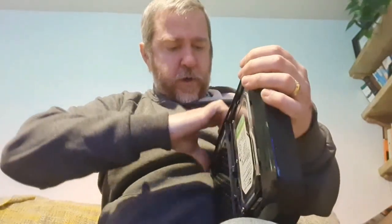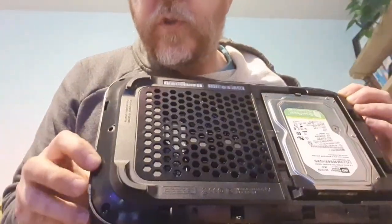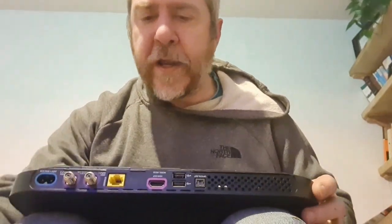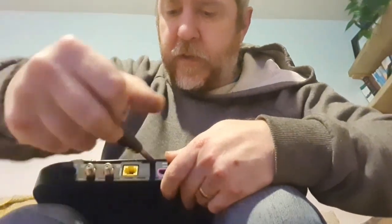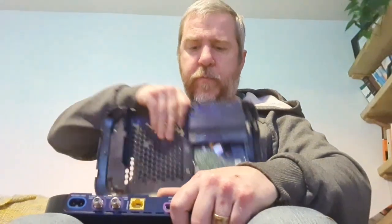Let's see how we can pull this apart - should be fairly straightforward. There's the first panel off, that's just the base. What that reveals is some areas where it's screwed on - there are some little screws there. Four screws are out. We'll try and separate the two halves now. We can use the screwdriver as a wedge and pop off that top piece.